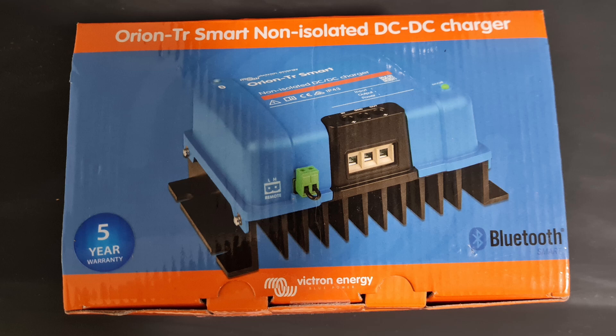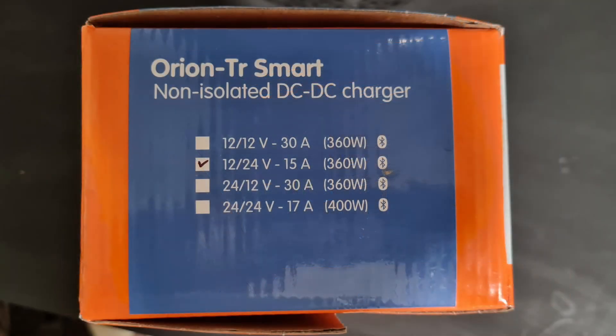The secondary reason was that I've always run a non-isolated system, so I didn't really see the need to do anything else. The isolated version will always be a little bit dearer, but if it's not outside your budget and it's readily available, I would go with that by preference. However, having said that, it doesn't really matter — if you talk to anyone about these systems, it doesn't matter about having the negative rail isolated between the 12 and 24 volt systems. There are a number of different models in the Victron Orion Charger range, so you need to make sure you get the right one.